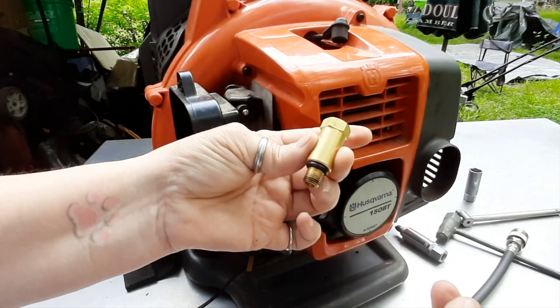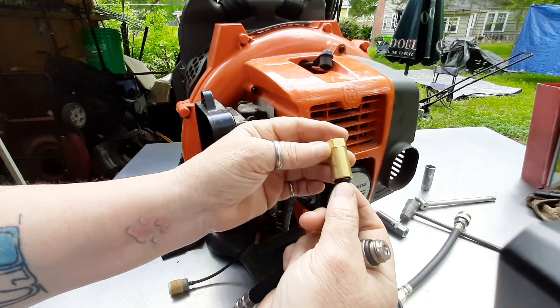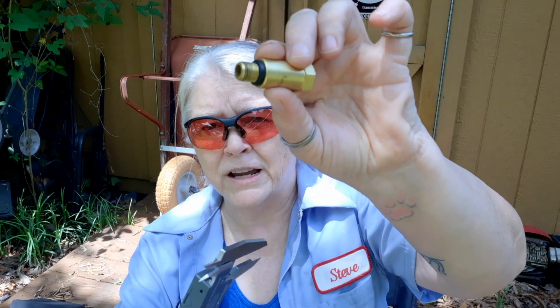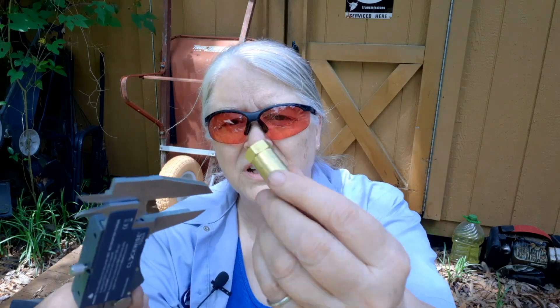I use this as the worst example. So much reduced compression because we've increased the cylinder capacity by that much, which you might not think is a whole lot, but let's do the math on that. If you look inside of here, you're going to see that basically this threaded part is one section. It has one certain diameter and length, and then the other part where you're going to screw your compression tester into is a different diameter and width.